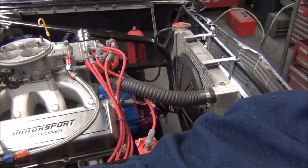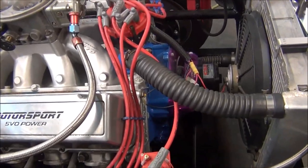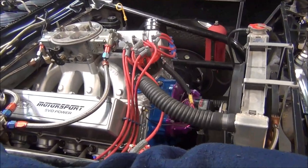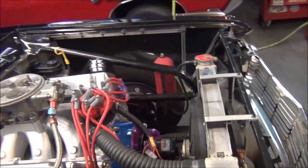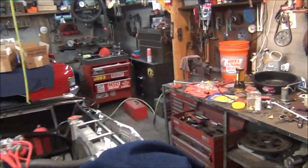And that's the way we do a lot of drag cars. I've tried it with an advance hooked up, and I just didn't like it. My springs are always sticking and stuff. And on a drag car, you don't really need that when you got the right converter and gear and all that. But I do have a start retard hooked up to my MSD box that should not let it do that. I may have to see if it's set wrong or something.